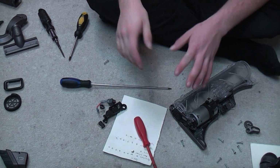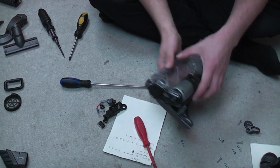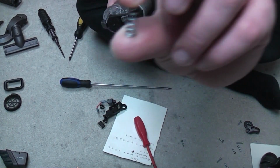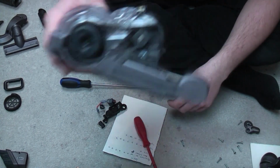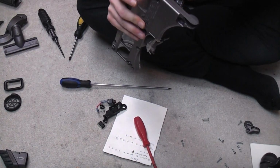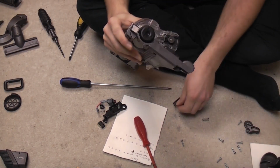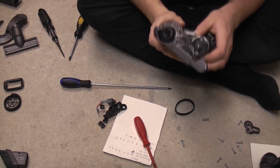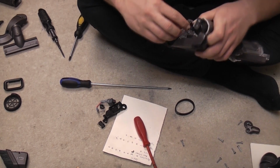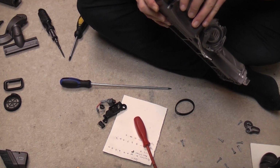Okay, so I am watered, batteries charged up a bit on the camera, and I have the head quickly apart because we've missed a spring. There should be a spring that sits in that part there. I thought the belt went on just a little bit too easily, so we'll have the belt off and hopefully we can just pop the motor out, put the spring in and just put the motor back in.